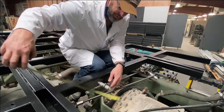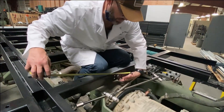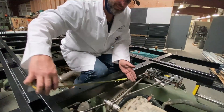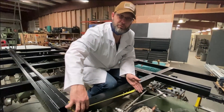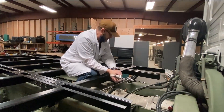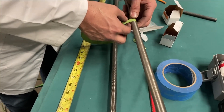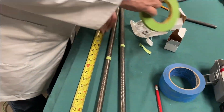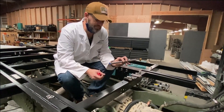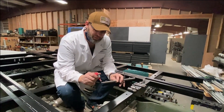For the LMTV on this particular frame, this bolt needs to go in this hole, and these two bushings will slide up inside here. I need to bring it all the way over, so I measure that distance — 11 inches — and I'm going to shorten this shaft to 11 inches. Mark and cut off the extra all-thread length with an angle grinder or chop saw, then use a file to remove the resulting burr. As we reassemble, I'm going to screw the shafts back into the heim joints — always good to use a little bit of Loctite to make sure things don't come apart in the field.